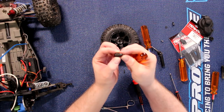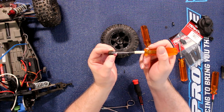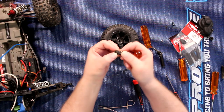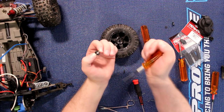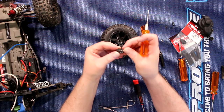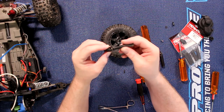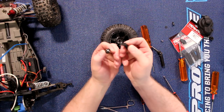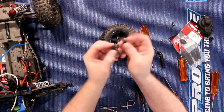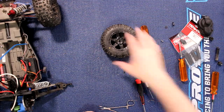If you're trying to find it, you're able to see this part and usually they're just a little bit lower, and you'll be able to get in with your screwdriver and remove it. Normally I would try to save this ball and transfer it to the new one, but in this case I won't because the client physically tried to re-glue this together. Unfortunately with this kind of plastic you cannot glue them — they don't glue well and they just break again. These parts we'll put aside.